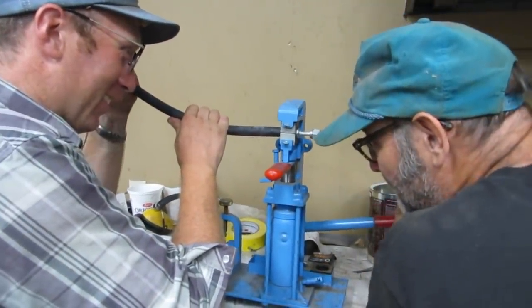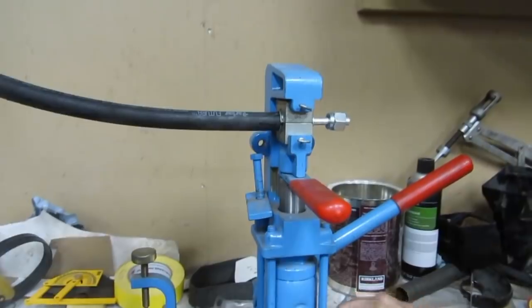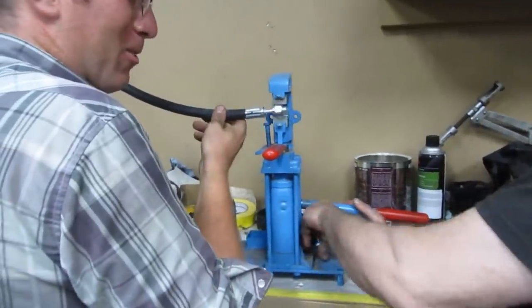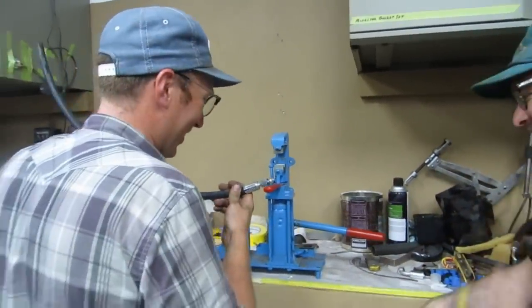Oh, yeah. You get a slight hose extrusion. They grow by about a 16th of an inch. You're going to have to compensate. You want to shave a 16th? Look at that. It really puts the... And that's just your Poisson's ratio, how the material is getting a lot smaller in one direction, so it has to go somewhere.